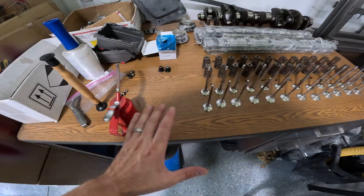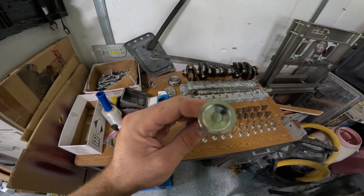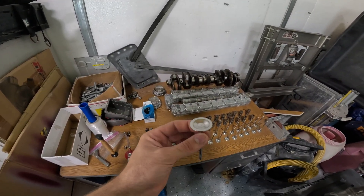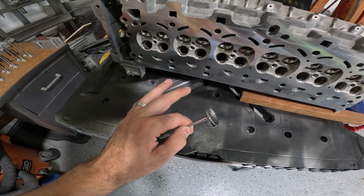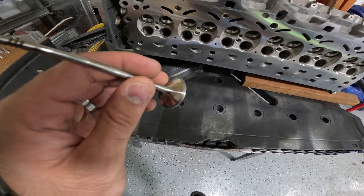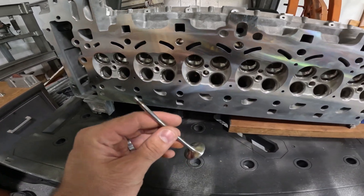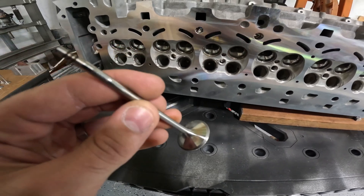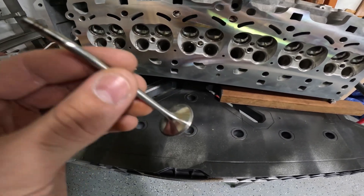Alright, we're all done cleaning the valves. Every single valve is nice and clean and free of carbon. I know from factory there's a special coating that sits on the inside of the groove — that coating might be important or it might not, you guys can comment below. But I did this with my old head and it had no issues for over 20k miles. Now we're going to lap these valves — just a very quick lap job, we're not going to spend too much time because you don't want to take too much material off. Some valves might have very light pitting; if they have too much pitting I would change those valves out.